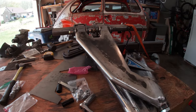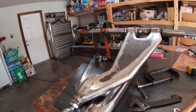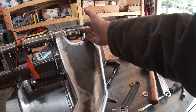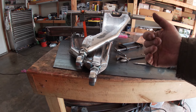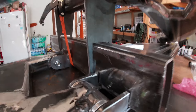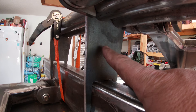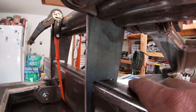Here is everything kind of just thrown together real quick. Did have to redo a few things on the bulkhead, but all is well. So now I've got to scoot these mounts forward, then scoot that mount forward to match, because once I get this right on top of each other, I can put the knuckles in. And from the front of the knuckle where the tie rod connects, I'll be able to see where I need to put the steering box. Here's the little quarter-inch plate bracket that I made. I'm going to make another one to hold the steering rack and drill a hole through the middle so that the center universal joint for the steering could go right through it. Then I can gusset everything up and make everything permanent.